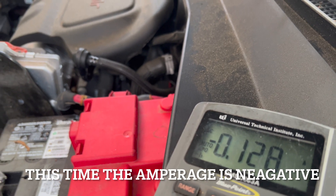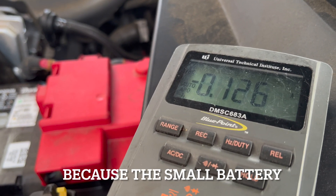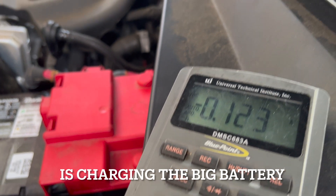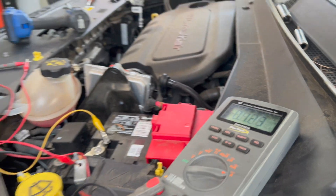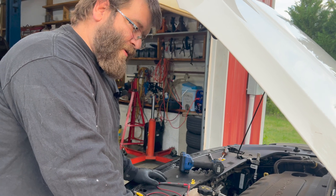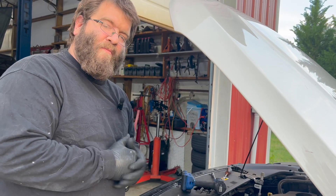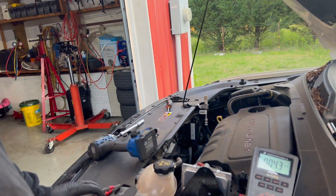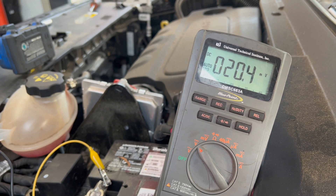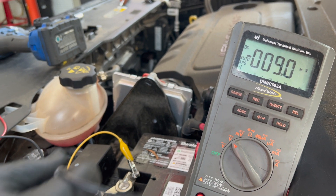Our main battery probably still isn't quite fully charged, so it is probably still pulling a little bit from the auxiliary battery to equalize even better. After this, you can put a battery charger on it, or you could drive it for about 30 minutes to help the battery. This is a whole lot better than with the old battery in it. We put our leads back to the test bolts and put our meter back on the voltage setting to make sure both batteries are being charged.